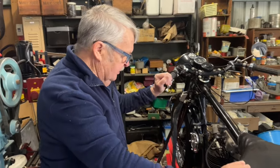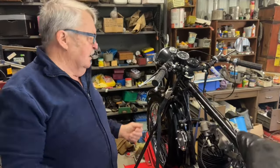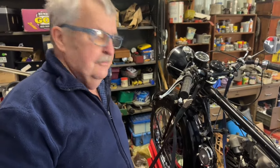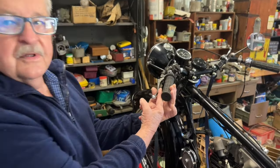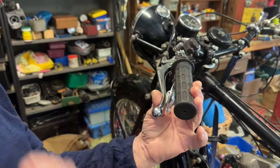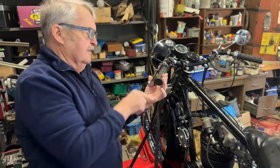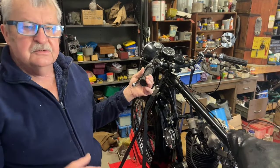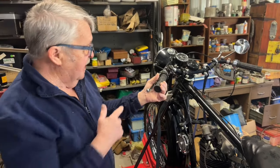With this bike, it's got some clutch issues — the clutch was slipping. Now if you adjust your clutch up and it's not slipping but it won't free, you'll find that the lever won't pull into the handlebars, which it has to. You have to get a full one-inch throw on the lever. So that means there could be a couple — maybe three — reasons for it.